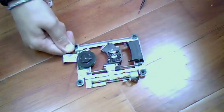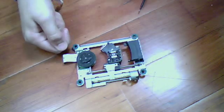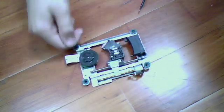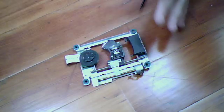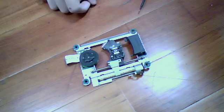Pry up on the quarter on the right side, spin it about a third of a turn or half a turn, do it again — a third of a turn or half a turn — and do it about ten times. Not so it pops off, just so it's a little higher up. Then put your disc on and make sure it's not screeching anymore.